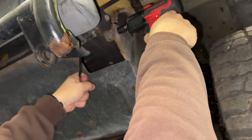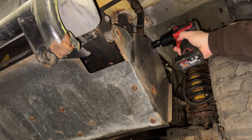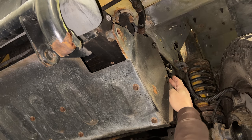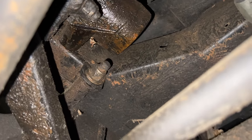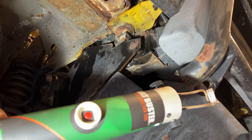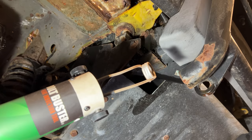I'm going to remove the skid plate. This bolt here also holds the front bumper on. These lower bolts right here go through the brackets for the steering on this side — if you had a right-hand drive, it would go through the steering on the other side. That's the nut that's spinning on the other side of that. Some of these bolts are really stuck, so I'm going to use my Bolt Buster. Instead of using a torch to heat them, this uses electricity to heat up the bolt. It has a little coil that you put around the bolt head or the nut that you want to heat up, and this will safely get the bolt red hot without using a flame.